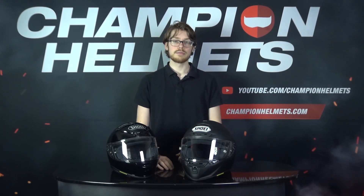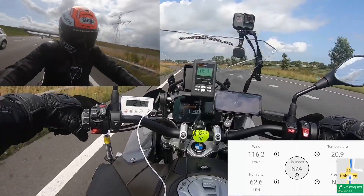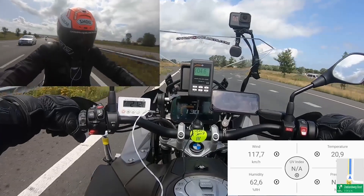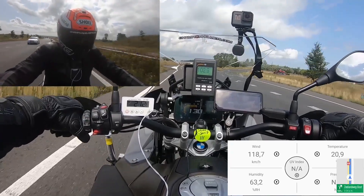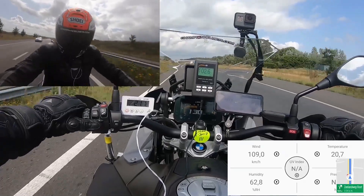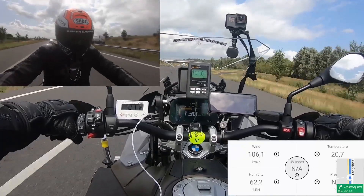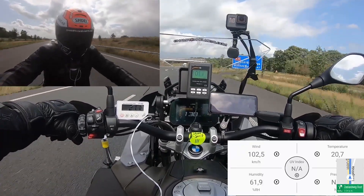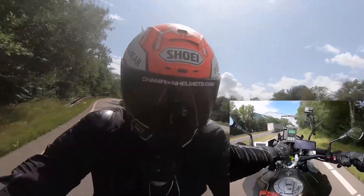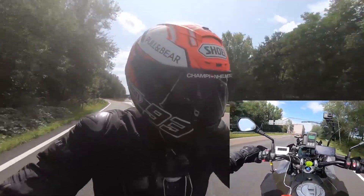Let's see how the X-Spirit 3 does on the road. We tested it in fair weather with the exterior temperature at about 21 degrees Celsius, and the helmet's interior reflected the same — pretty good. We can expect the ventilation to work even better at higher speeds in a racing position on the track. The wind speed was about 115 km/h and the helmet came in at about 103 decibels — the same as the NXR. Our rider was very positive, saying it ventilated well and was very comfortable without any pressure. In the end, it lives up to its top quality name.